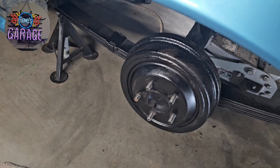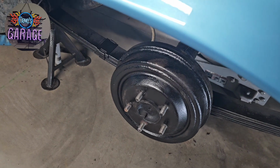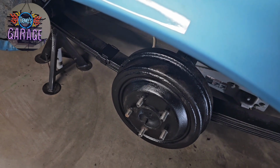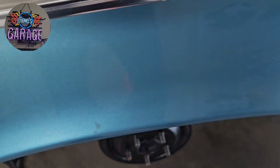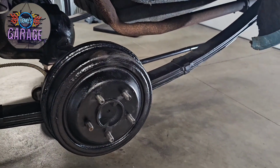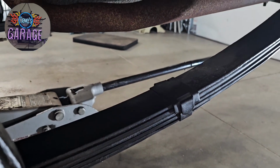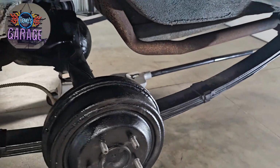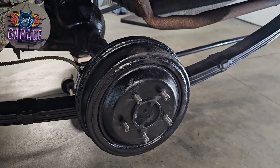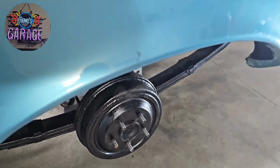So measuring up this wheel well opening and backspace, I came up with 4 1/4 backspace, or 4 1/8 backspace on these Cragars. I'll have about 1 3/4 inch clearance between the rim and the leaf spring, and I sized the 275/60/15, 60 series, and I'm afraid that it'll rub right there on those spring clamps. So instead, I got a 235/70/15 coming, and I'll show you the tire when I get it here. It's kind of a cool tire size. We're going back to radial tires on the back end too.